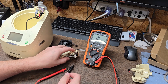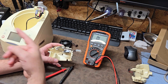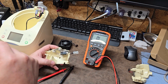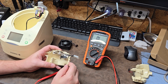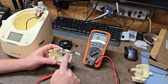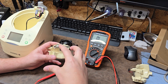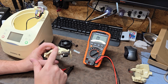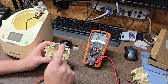I've never taken one of these Medela pumps apart, but if it was just a relay clicking on and off for this heating element - since it's heating up milk - it would heat up way too quickly, then shut off, then heat up way too quick again. So it's going to pulse electricity to this very low resistance heating element. And if it ever gets too hot, you have this thermal disconnect. In a plastic case, if the thermal disconnect failed closed and the fan quit working, the heating element would melt the upper casing - just dissolve it into a big schmoo. So we have a thermal disconnect here.